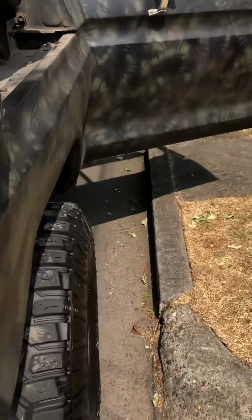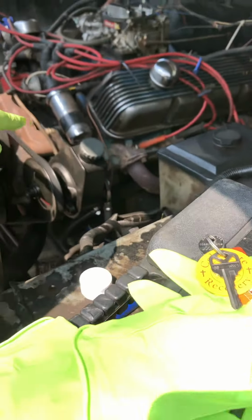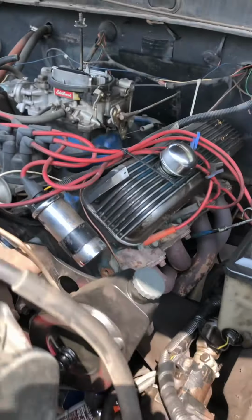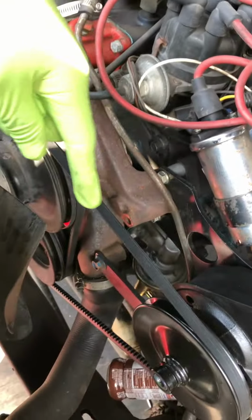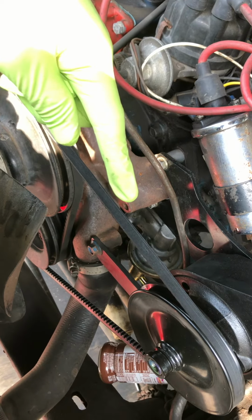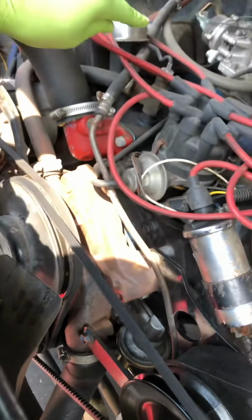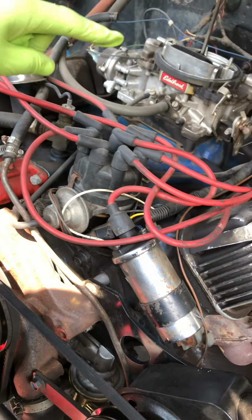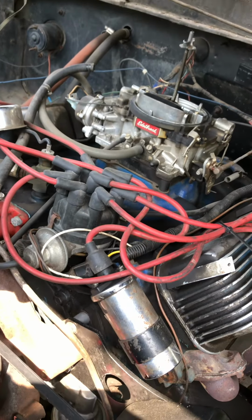And my fuel filter is nothing special, nothing fancy, but the fact that I'm getting fuel from the tank, but not from the fuel pump up there, even when you're cranking the motor and the motor doesn't want to fire, that pump should still be pumping, actuating the diaphragm that's inside there, pumping fuel up this hard line through this soft line to the carburetor. So that's how you can determine real easy if your fuel pump is bad.